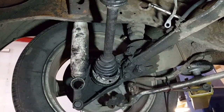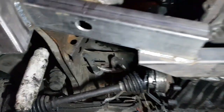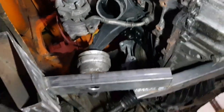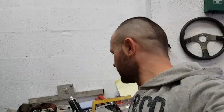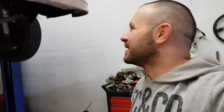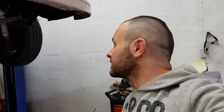This is the angle of the drive shaft - not exceeding five degrees, so very happy with that. Overall very good, look how much space I've got. Hopefully Nick's going to make the right decision - the only right decision is to go for about 300 brake horsepower. I mean, that's going to be stupid but it puts a smile on your face - why not? It gets me excited.